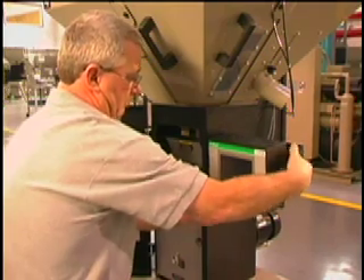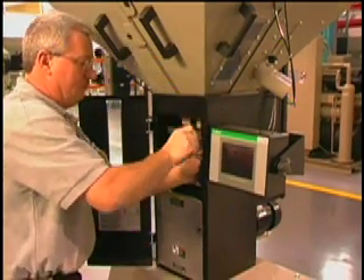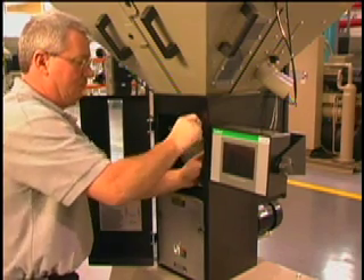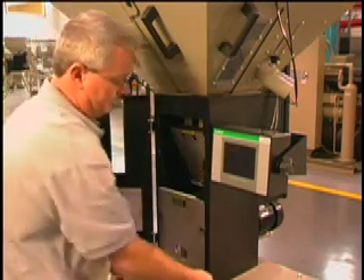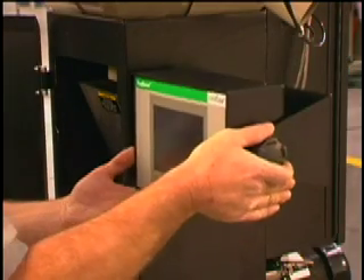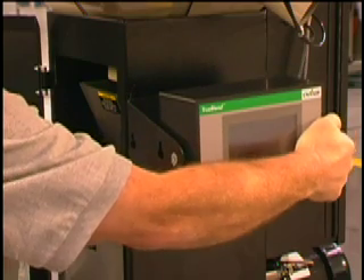The control for the True Blend can be fixed to the housing with two screws. The two screws are captive on the right side of the chassis. Once the control is in place, tighten the screws and lock nuts inside to keep the control from vibrating.